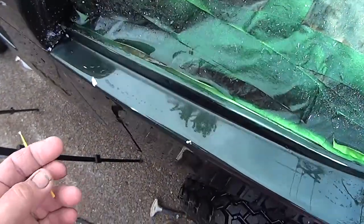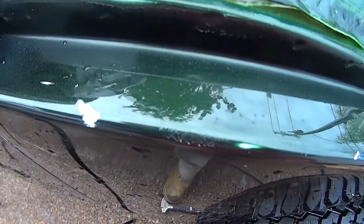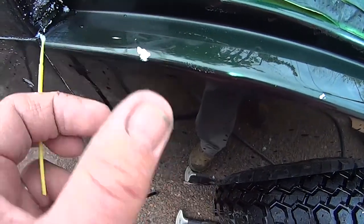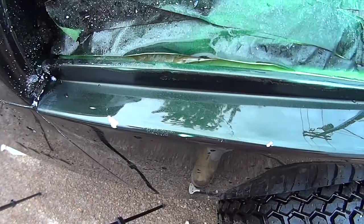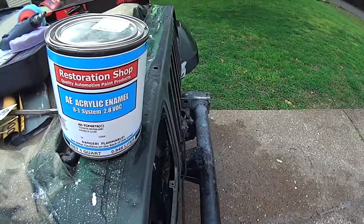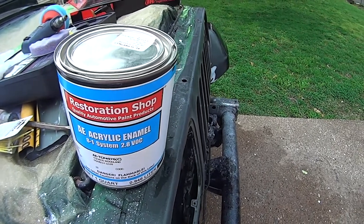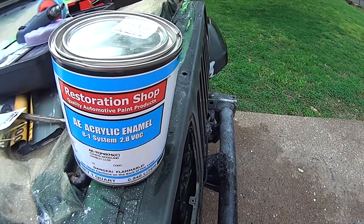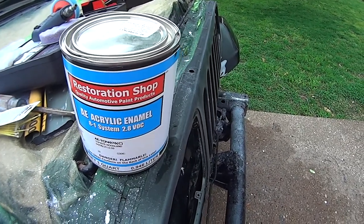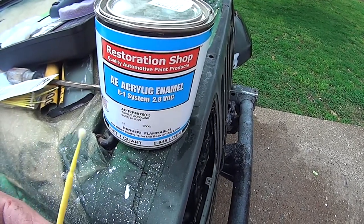I've got a couple little chips here from when I had the hood sitting down on the truck, right here where the hood comes up — you barely see that. So I'm going to touch that up a little bit without repainting the whole truck. I bought a quart of the same color code in a single stage acrylic enamel — basically a really good touch-up paint. When you go to the store like AutoZone, you're getting kind of lacquer paint most of the time, which dries really super quick. But we're looking at acrylic enamel, and these little micro brushes work great for it.